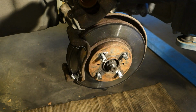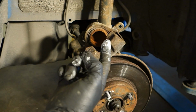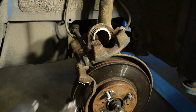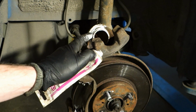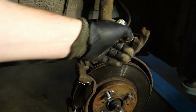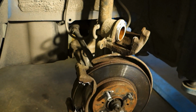What is this? The brake caliper. And in here, in this brake caliper area, I can insert my grease in that area. I take more, especially in this area. And what makes contact with the brake pads, this is good. And then this rubber sealant in here, I can insert lubrication even in that area. And there is actually a little bit better brake rubber lubrication, but if we insert a little bit of grease in there, it is not bad. And then that other side, in this area, I can insert this lubrication. Okay, good.